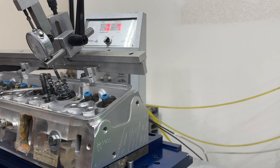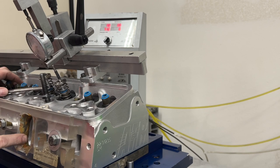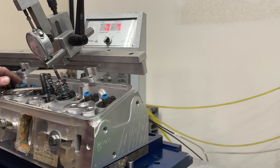And what I've done here is, this is a 1206 plate, obviously. But last time I used this plate, I was using it on something with a 1205 entry. So actually, the clay is smaller than a 1205. So you could think of this as simulating a 1205 entry intake manifold. In other words, your regular Victor Juniors, they come that way. Your Performer RPMs, they come that way too. And you bolted on something that was 1206, what would it do for flow? So we're just going to see.